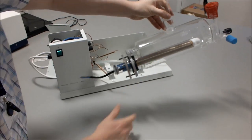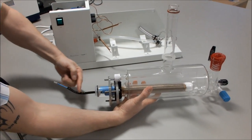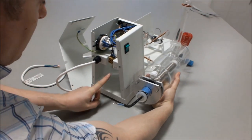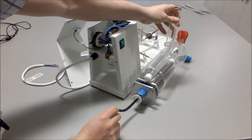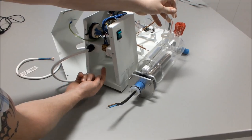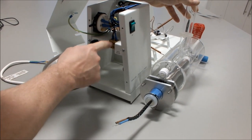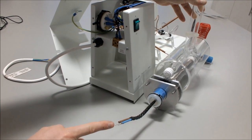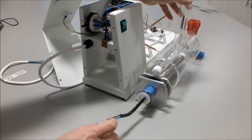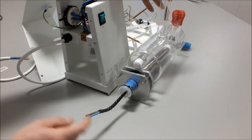Now place the boiler onto the stand. Make sure the heater leads come up and fit exactly into the heater terminal block. If they are twisted the wrong way it will be extremely difficult to attach the cable. Therefore, ensure brown is on the left and blue is on the right when you slide the heater in. If they are the opposite way around, slacken the fitting and turn the heater until they are in the correct order.